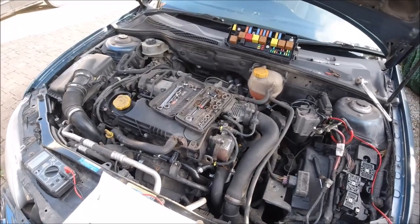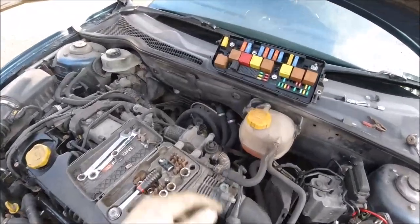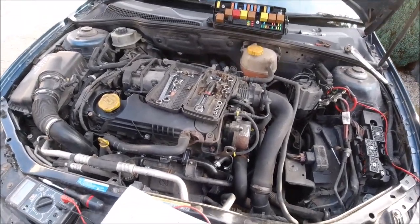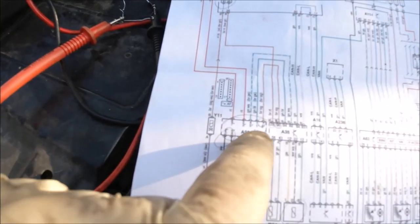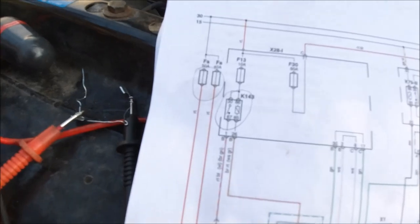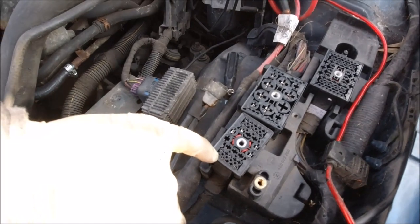So we have a problem with the relay switch. One of the legs, that's actually the 85, doesn't have the power from the engine ECU. So that's the diagram. This is the relay. This is the part of the engine ECU. And we have to check the leg 29, because the 29 is connection actually to the fuse box 26, and the 85 leg to the relay coil.